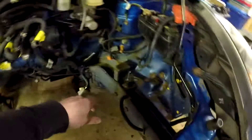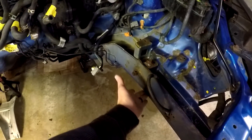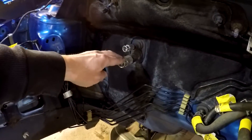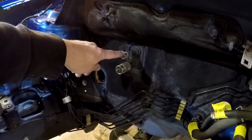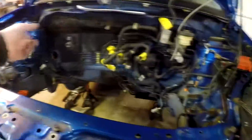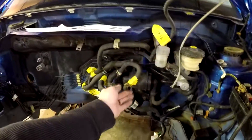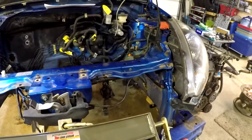This mount has to come off — the passenger side mount — you have to trim a little nub on top, which we'll get to. Same with this mount over here, took this one off too; you have to trim a little piece on that, plus do a little trimming on the subframe for the K-series transmission. This big AC line comes off with the engine and stays on the AC compressor as one unit. This little line you have to take off here — it's a quick connect — and it routes around through this clip, so that one has to come off too. You see all this yellow tape? I just marked everything — fuel, heater hose, evap hose, vacuum hose — so there won't be any confusion.